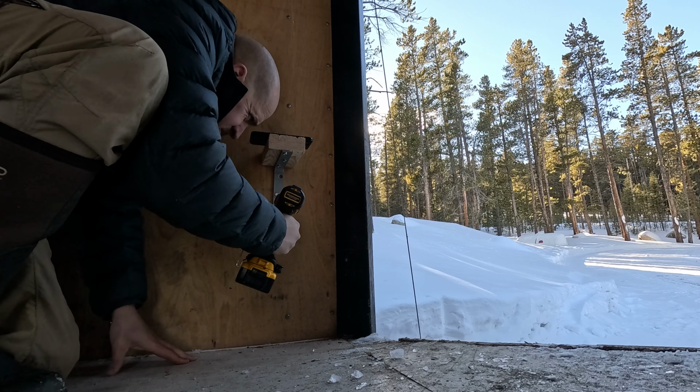Okay, so this thing was starting up and I kind of abandoned the first start because I was worried that I had the exhaust pipe and the intake pipe in the wrong location. Okay, so on the screen, this little guy means the glow plug is heating up. This means the fan is spinning. This looks like air is going in and out. Yeah, so this should be drawing like 125 watts on startup. That's why I wanted to put that AC to DC converter in there, because when you're starting, okay, the pump is kicking on, so pump icon is now on. Oh yeah, we're getting some exhaust burn off here. Definitely some packing oils and stuff that's burning off.